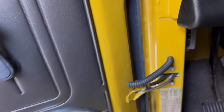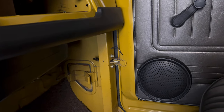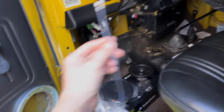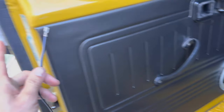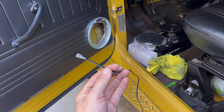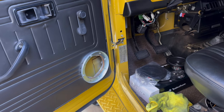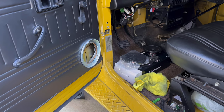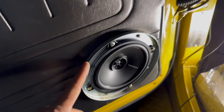This is the size drill bit I needed to put a larger hole. It definitely hurt but this looks way better — more professional. I'll take this any day over speaker wire just hanging in there. I had to open up the holes; it was not fun but the result was definitely worth it. The way they had it wired originally, the speaker wire went straight from the radio to the speaker, so you would have had to snip the speaker wires just to get the door off. Now with the boot it's a bigger hole — I'll be able to feed the wires in and out and remove the boot if I need to. It makes it more serviceable and user-friendly instead of being hardwired.